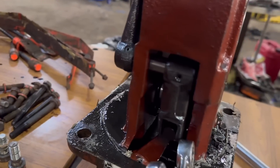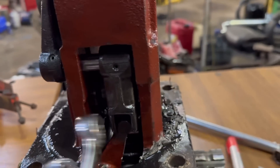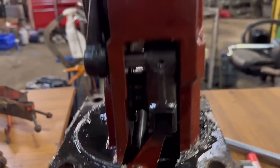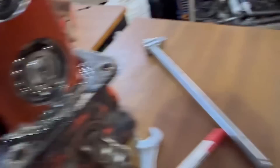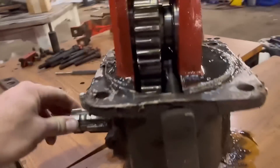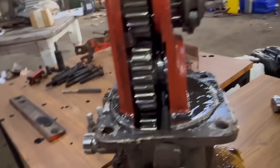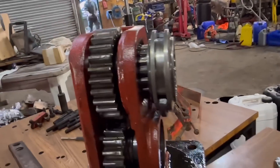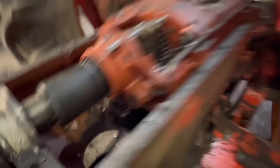You see where it engages itself in and out of gear by sliding backwards and forwards — this gear slides backwards and forwards on that shaft and makes it mesh from the top to the bottom shaft. It's a little bit scored on the teeth as well in there. When you want to engage four-wheel drive, that slides across and the teeth grip on, so that gear puts it into four-wheel drive.